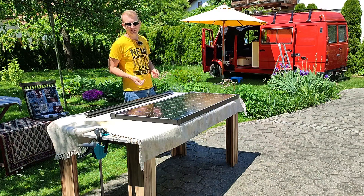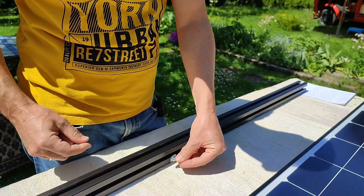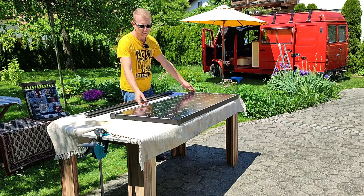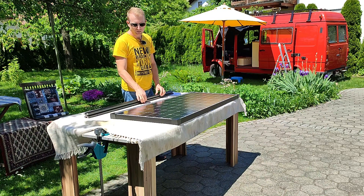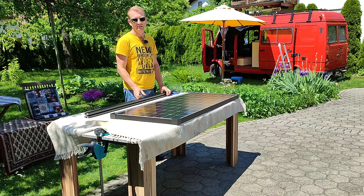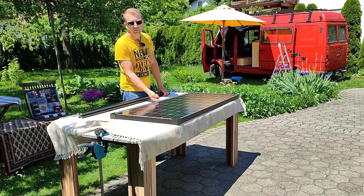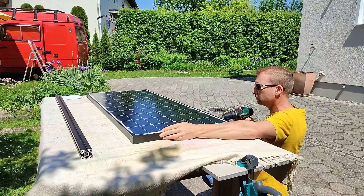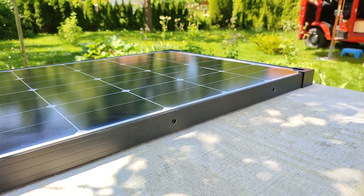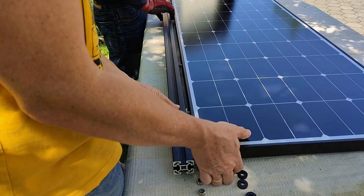Installing the solar panels turns out to be a little more complicated than originally expected. We want to use hammerhead bolts inserted into the aluminum profiles, but the problem is these bolts impede inserting the panel from the top. The only way out is to partially dismantle the roof rack and assemble part of it on the table. So we removed one aluminum profile and now we drill a hole into the aluminum frame of the solar panel. Of course it's an awkward moment when you drill the first hole in your new 400 euro solar panel, but concerns are for no reason. After drilling the holes we insert the hammerhead bolts and attach the aluminum profile to the frame of the solar panel with self-locking nuts.